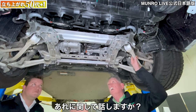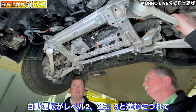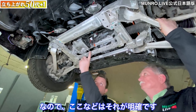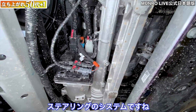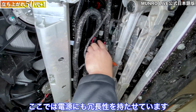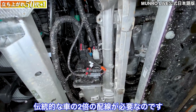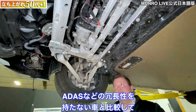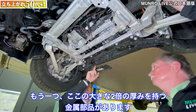With the advent of Level 2, Level 2.5, and Level 3 autonomous driving, you have to have redundancy in your critical systems. You can see very clearly the redundant low-voltage circuitry on the steering system. We've done full teardowns of the Model 3 and Model Y — they're even doubling up on power supply, so you see positive, negative, positive, negative — twice as much wiring as you'd need in a traditional car without redundant circuitry for the ADAS system.